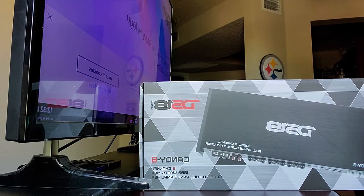I'm not going to go into peak power, because peak power, for anybody who knows, doesn't mean squat. Quite honestly, it really shouldn't be something that companies are able to advertise on the box, because what do I care if the peak wattage for the amp is 2,000 watts when it only lasts for 1 or 2 seconds? That's ridiculous. Before it blows, who cares? If I want to listen to my speakers, I want to listen to it more than 1 or 2 seconds. So it's all a ploy for these companies to prey upon the ignorance of the consumer. And it's sad. It's really sad. Any real company, they're going to put the RMS, because that's what makes a difference. What is the continuous power that the speaker can take?